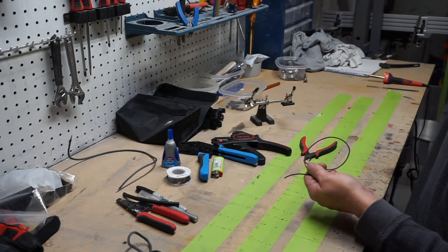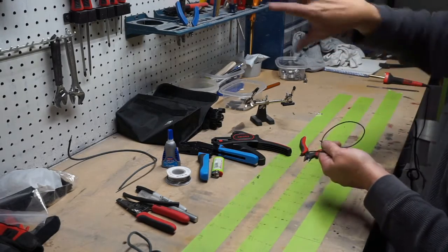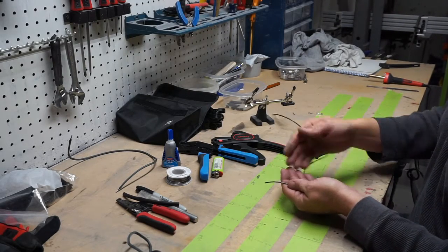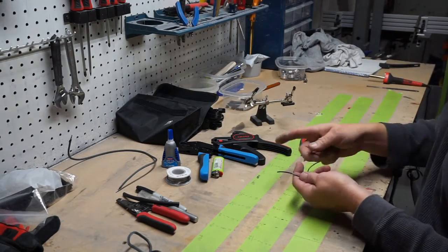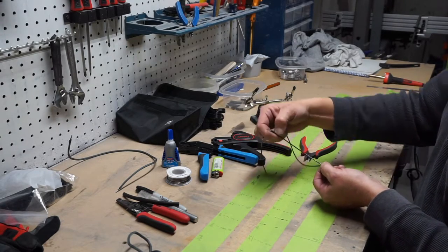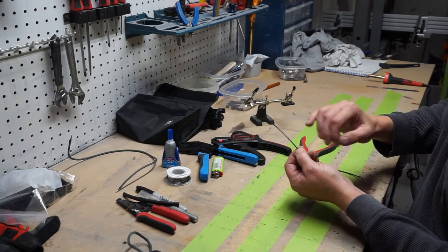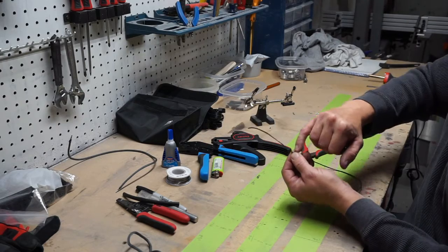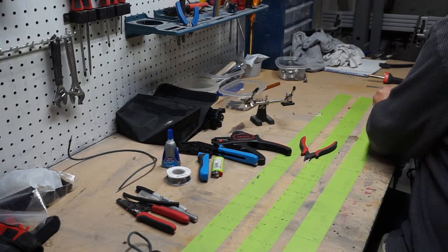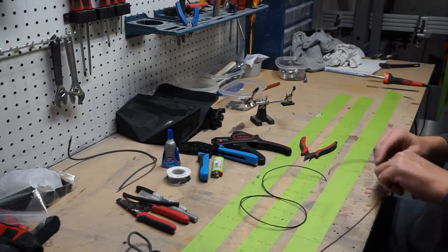We obviously don't want it next to our connector on the 24 pin, because we don't want to see it through the front of the side of the case. So for us, it's going to be best to put it down by the power supply, since we're going to have a cover over that anyway. So we're going to keep it relatively close to the end where it's going to go into the power supply. I'm thinking about that far away. Now what I'm going to do is mark that out and cut me a wire that length. I haven't cut a wire that length, so I've got to do that.